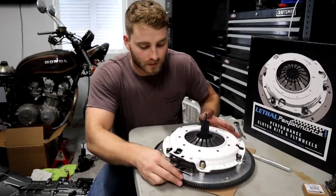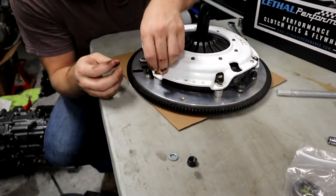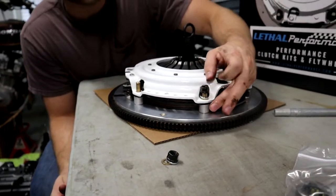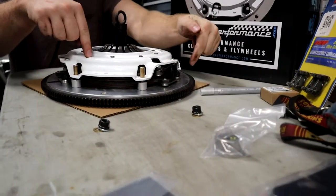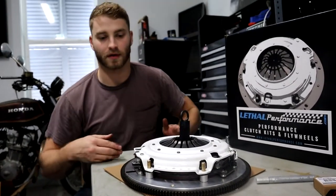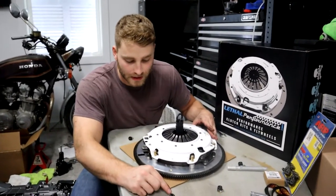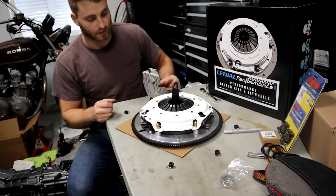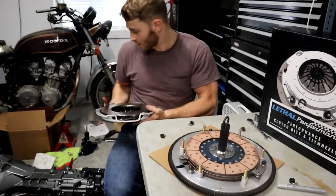And so I'll set that one there. As I take off the locking washer and the other washer, I will set them in the appropriate order that they came off, all next to each other. That way when I do this one, and I take off the locking washer and the washer, it's in that order. I'm just gonna go around in counterclockwise order and put them in respect to the actual bolt that they come off of. All right, so now that I've taken off every single nut, and I know that this one's our painted nut and it's got a painted stud here, and each nut goes with its corresponding bolt, we can take off our pressure plate and flip her over and throw her somewhere else.